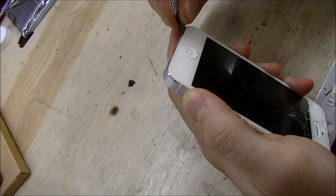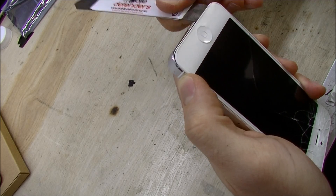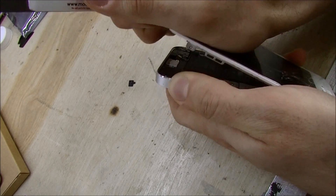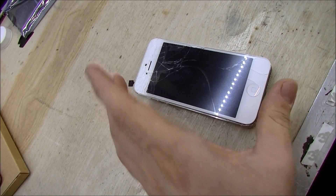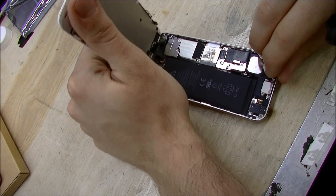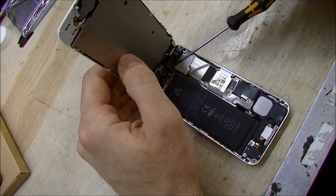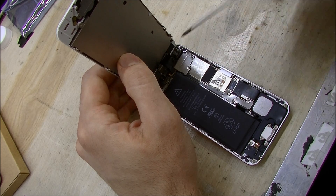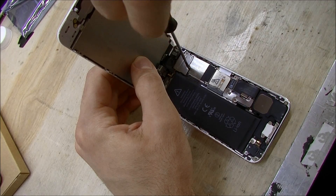And that's what I'm going to do. Beautiful. Repair technicians have been having dreams about this since the 4 came out. Now, the screen and the touch screen and the camera, earpiece and all that nonsense are all going here. So you have to take this cover off, which is held on by three screws.